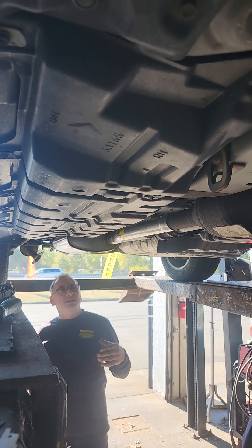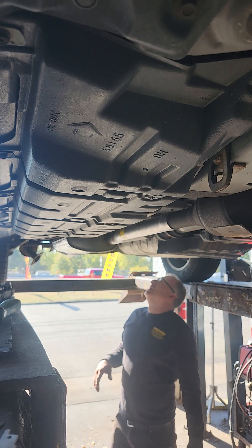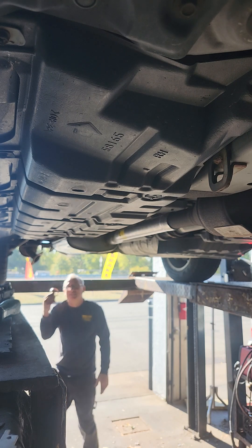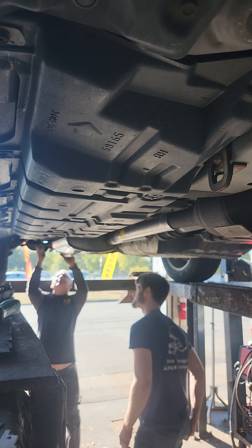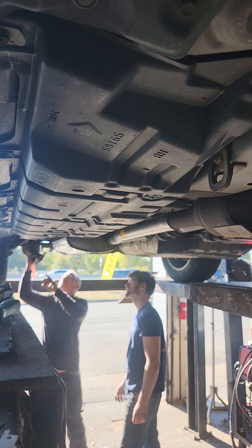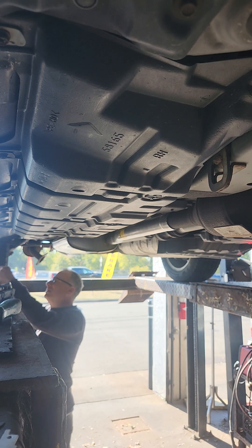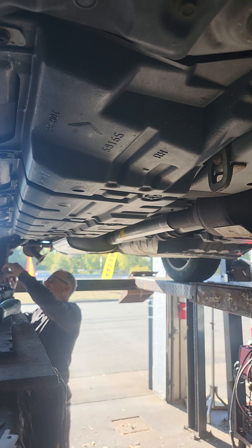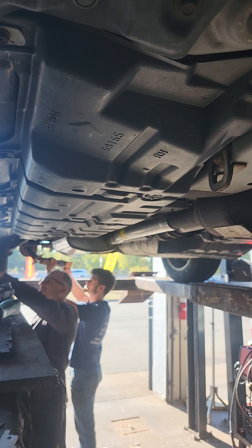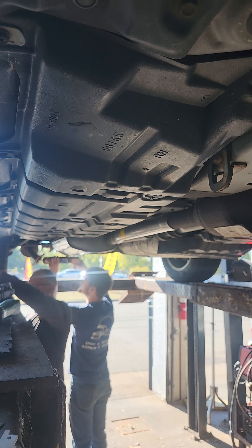The QuietFlow series is the quietest. You can clamp this if you want to — we're not going to do that. Is that the donut gasket back there? Caleb said donut gasket — composite material gasket. Everything looks good. I probably should use a little red RTV. This flange is pitted, so this should give a little smidge of that. These come with a bunch of different pieces to stagger off the flange so you can't just murder it down. This just ensures a better quality job for the customer — RTV high temperature silicone.